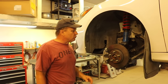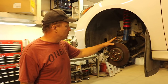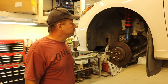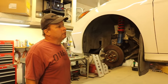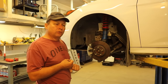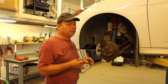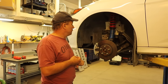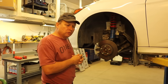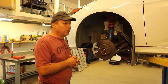The next thing I'm going to try on the front is a set of stock Focus uprights — I'll work on whether or not that's going to work and have that information in probably another couple of weeks. We also need to work on an oil cooler — we have a bit of high oil temperature when driving it hard, so engine oil temperature will hopefully be brought down with an oil cooler. There are a number of other items we need to work on with Ford Performance regarding ECU issues that may come up with the rear drive unit.